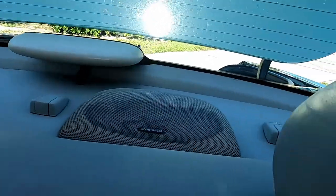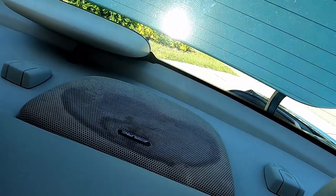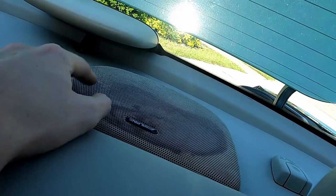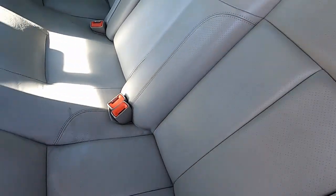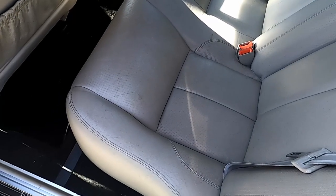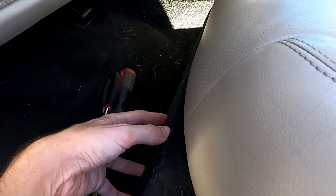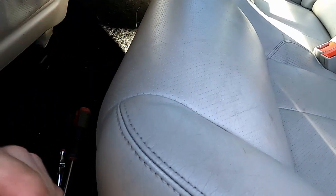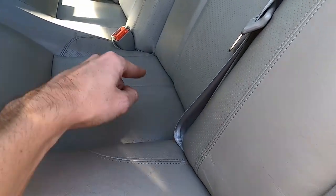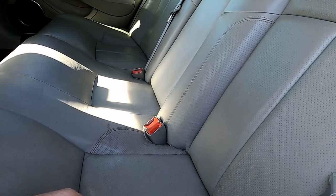That would also explain why the cone was moving so crazily in there. We basically need to remove the package tray. The speaker grill is a little bit faded — almost looks burned — so I intend to try and clean this up when it's out. To pull the whole package tray, you have to move the seat back, and to do that you have to remove the base of the seat. They've done a good job of hiding all the hardware — there are panels underneath and you have to pop those off to access what I believe are torx bolts. Once the seat base comes out, there should be bolts along the bottom, and once those are undone you can lift the seat and pull it forward.